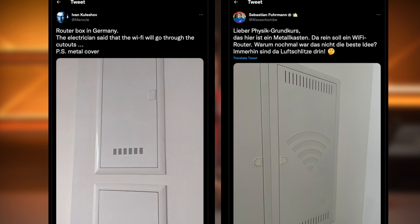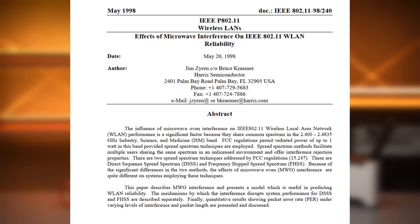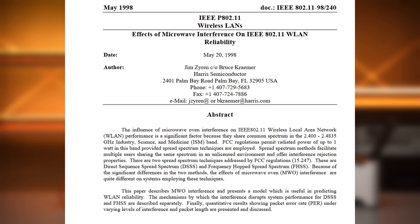Today's topic is the Wi-Fi signal. So many weird setups, so many misconceptions. We've seen routers in metal boxes, or glued to the back of a TV, or on a microwave. But hey — aren't microwaves shielded? Sure, as they should be. However, routers can be very, very sensitive. Microwaves can and will jam up the nearby frequency spectrum enough for you to notice, and it has been known for years. But the top of the microwave is such a nice storage surface — almost irresistible.